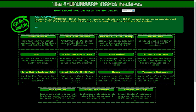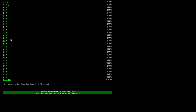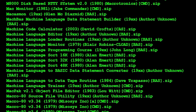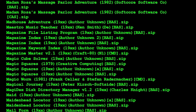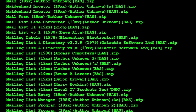But what about transferring individual applications to a floppy disk? There are thousands of TRS-80 programs archived online in several different formats. You'll find Cassette BASIC files, typically in a .cas extension, and application files for DOS in a .cmd extension, as well as complete virtual disk images which might have a JV1, DSK, DMK, or IMD extension.